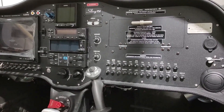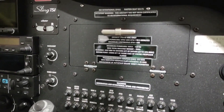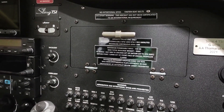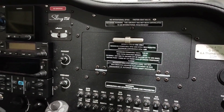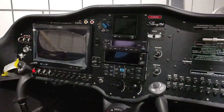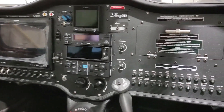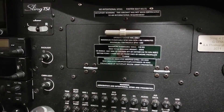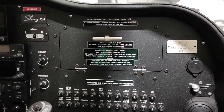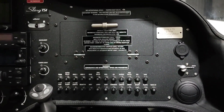There were a few other changes during the final inspection to comply with UK CAA and LAA requirements. The placards and warnings are quite different from what's provided in the kit — they need to meet UK requirements, so I had to change all of them, print new ones and stick them on. A notable one is the autopilot placard: no engagement below 1,000 feet is one of the things that has to be listed, and you identify these items when going through the inspection check sheets.